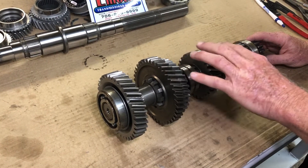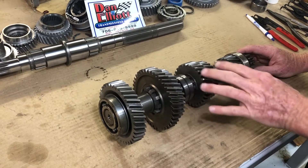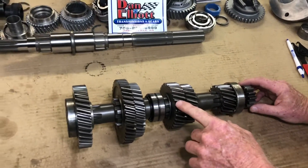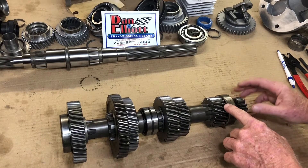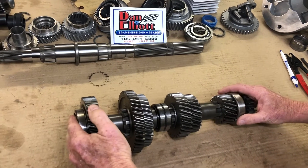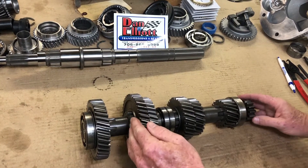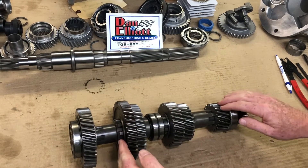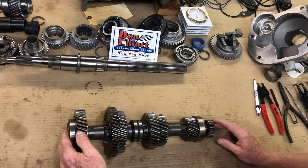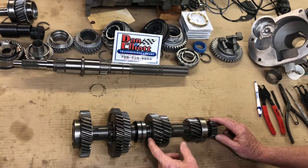They may or may not be able to turn around on the shaft. I think you can reverse these if you want to, though you may not be able to on the second and third gear set. What I like to do is take the reverse gear off, then press off the end gears because the bearings hold them on, then take the snap rings off and remove the gears. I notice by the shaft that all the gears from this point back load the shaft this way, and the input set gear loads the shaft from the front. So I'm going to get my electric pencil and mark my gears.